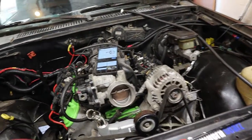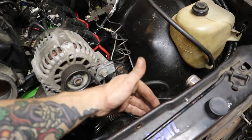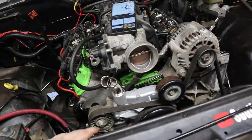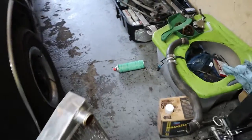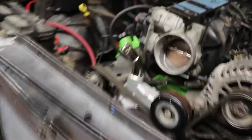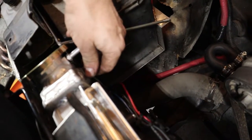There are a few things like the radiator hose — the other radiator was shorter and the inlet sat closer, so it reached easily, but this one does not. I found that if you take a Silverado radiator hose — because it has that long section — you can cut it down. It has these connections that I put in, so it's basically just a factory hose. I had to do a little tweaking but you just get a Silverado hose and it works great.